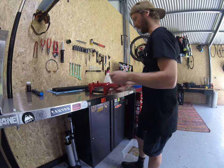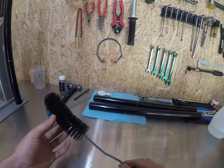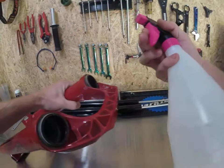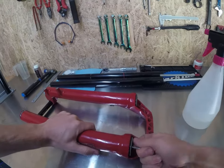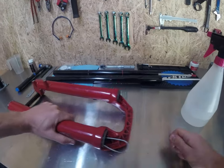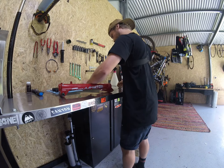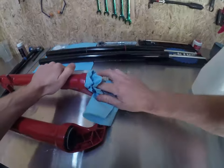There's still oil in the lowers, so we're going to pull them down and drop them in the drain pan for a minute. This is a tool I use to clean lowers out — it just basically scrubs it all down. Spray your isopropyl alcohol inside it and then drain them out. Spray isopropyl down the lowers, both sides. You can use blue towel, you can use rags — so long as there's nothing left in the lowers you're pretty dialed. These scrubby brushes you can get at your hardware store — this one is just used for plumbing, but you can repurpose all sorts of random stuff.